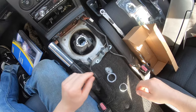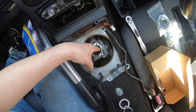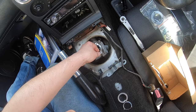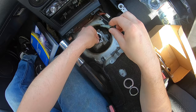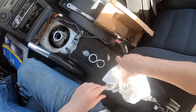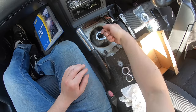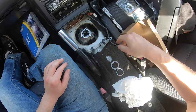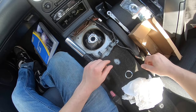On with the fitting. The first bit of the kit you're going to need is the turret spacer, your little spring washer, and inside here there's a little nylon bush — you want to pull that out, just like that. Drop that in the box. You see how easy that nylon bush came out? I've seen people hammering this piece out and all sorts of stuff — it's just not needed. Your turret spacer drops in nice and perfect.